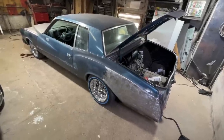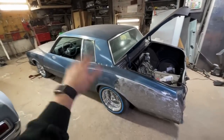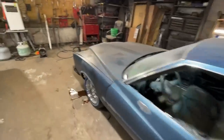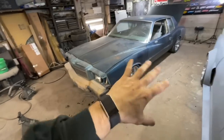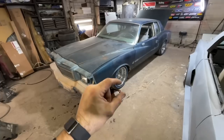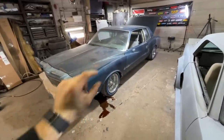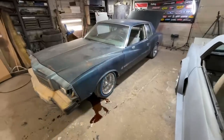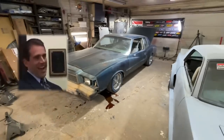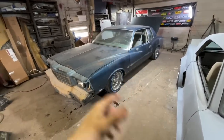It still doesn't drop super fast — I don't love that. The up fast was what I was more worried about than the down. It's still going down in five seconds but it's not instant. I'm so happy with how high that was. With the three-eighths line I only had maybe that much above my tire, and now it's like seven or eight inches — it's huge. We definitely have some leaks to fix. Got the leaks fixed — just changed out a couple fittings, looks like everything is fine.